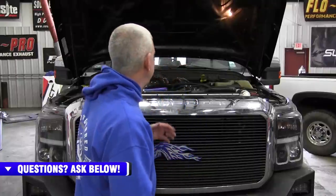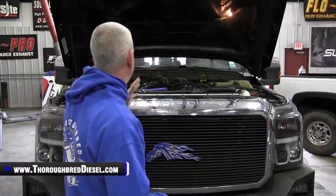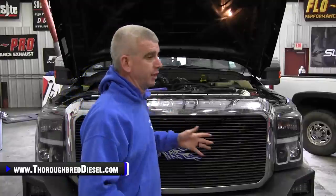All right, our BD6R140 pressure enhancing solenoid worked well for this truck. In closing, what you wanna do is make sure first off that you get your fluid level correct in the truck. I started out with 8 quarts. You may have to use a little bit more than that for your truck, depending on how much you let the truck drain. But once you get it to the correct level on the stick, check it with the truck running and in park. After you've run the truck and get it up to operating temperature on the transmission, if it makes it into the hash mark on the dipstick like we showed you, you're in good shape on your fluid level.